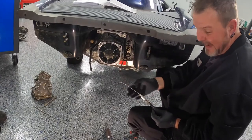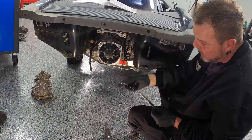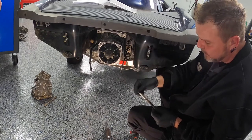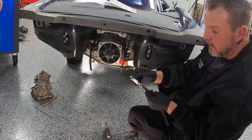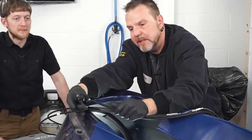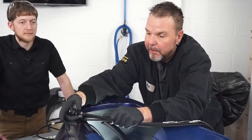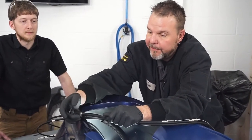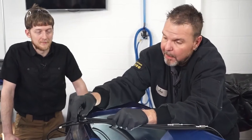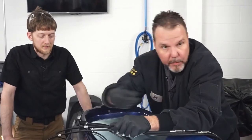If you're getting some binding like this, we don't want to lubricate these cables — that's not recommended. We're only lubricating pivot points: your ball sockets and where it actually goes into the handle — the throttle grip or quick turn system right there. On our new cable, we have a brand new seal. This is what's going to keep water out from inside our hull, so it's very important to make sure it's in place before you install this back through the hull.